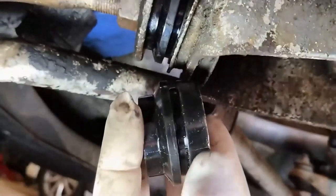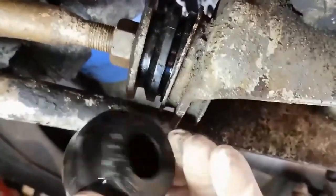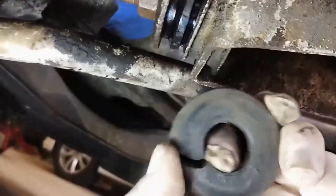I can see there's a problem: this wider edge won't accommodate the cup. The correct way would be for this dish to face the other dish, and for the smaller area to go into the cup. That edge there is too wide — those are the original rubbers. The left side would accommodate this dish, but it certainly wouldn't fit in the cup, and that's what caused this damage.